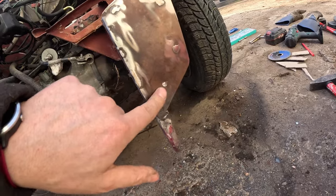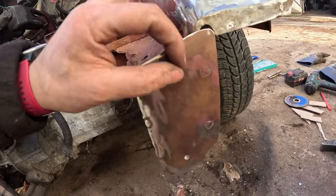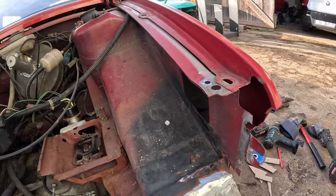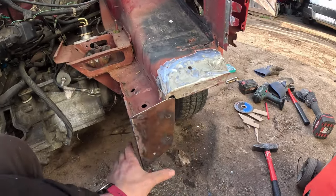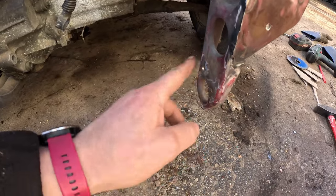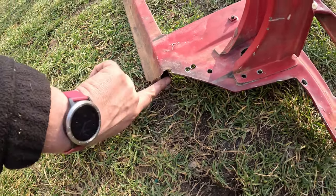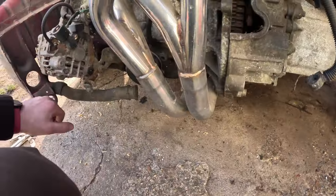This hasn't been welded in yet because I think I'll drill through it — and I think that will be the solution. So a bolt or a stud from this side, welded on this side. One here and one here, so that's three. We have a fourth one here, and I think that should be enough. Eight bolts — actually studs welded in so I can just put the nuts on. This is sturdy, plenty sturdy. I think I'll plug these holes and build backing plates here too, backing plates with captive nuts inside, so I can just drill a hole here and have one more bolt from this side, tying it all together down here.